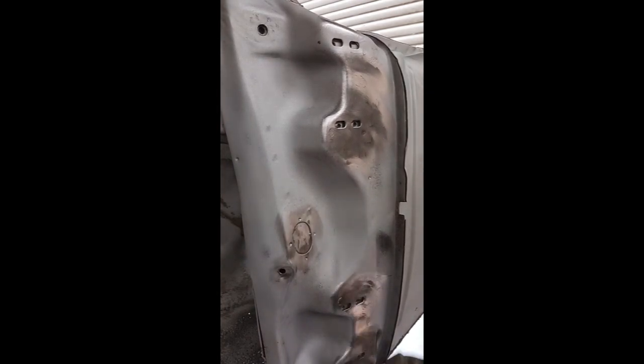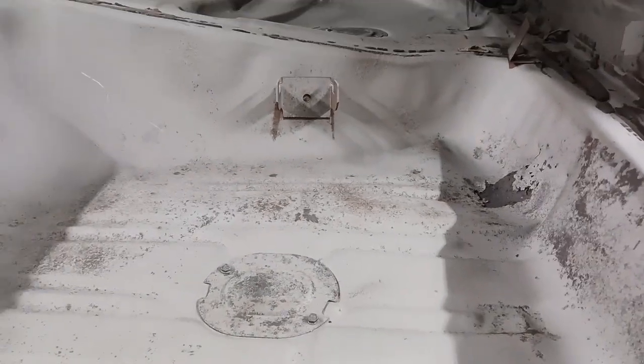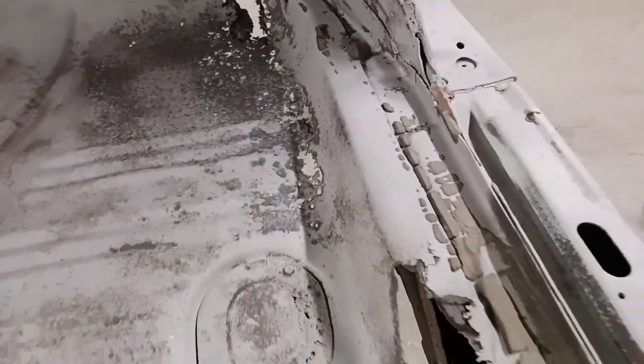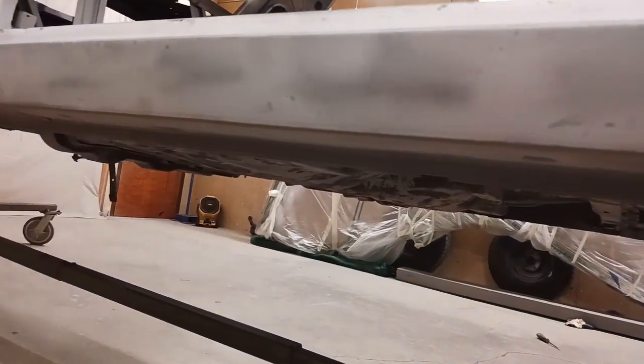It's always the little steps, the little details that really shine through on the finished product. Now we're scrubbing it off with Scotch-Brite. For revealed damage — looking at the floor pan, you'll notice it's not only the floor pan that's affected; there are braces underneath also. That goes into why when people ask for a quote on rust repair, it's usually never just one panel that's damaged — panels attach to braces or overlap other panels, and there are always adjoining rust issues.